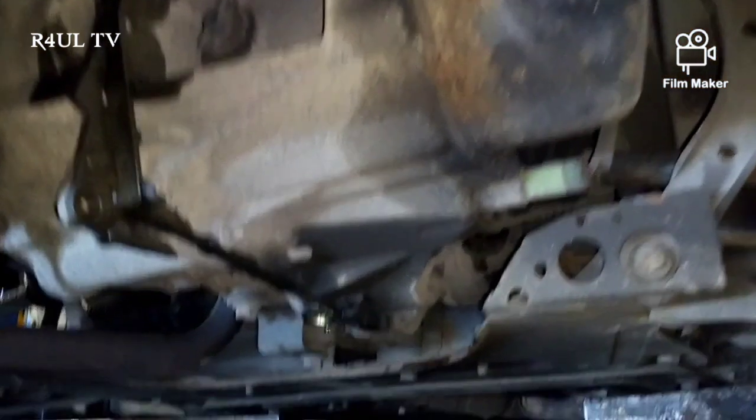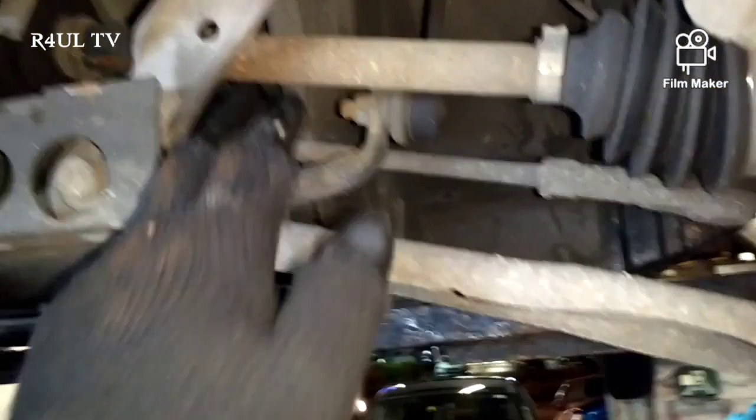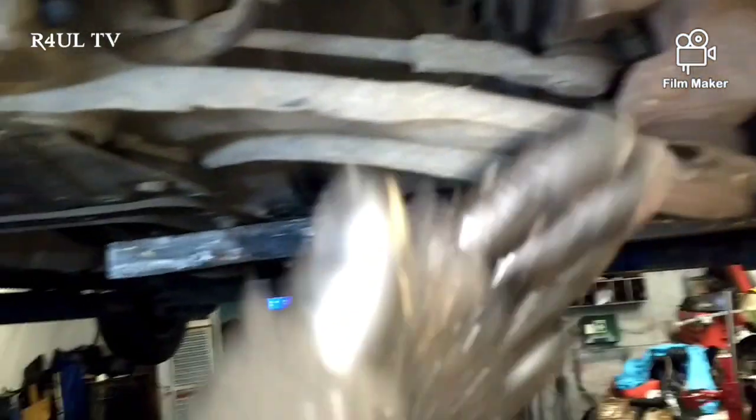As you can see I've sent the car up on the ramp. Like basically all gearboxes, it's the same principle on every single one - you have to take the drive shaft off, take the ball joints off, take the mounts off, take the bell housing bolts off. On this one you don't need to take the subframe off because it doesn't get in the way. On the driver's side I'm just going to take the drive shaft off. The passenger side I'll leave on - just take the ball joint off, and it just flicks out from there.